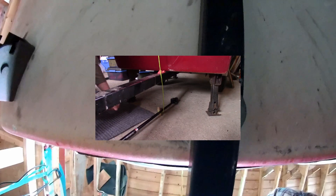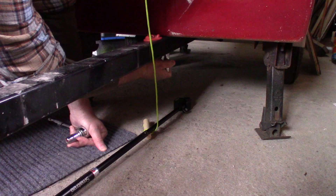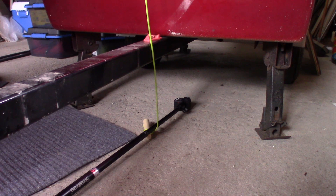I had thought this was going to be a lot more complicated than it is, but the tongue is just one 5-foot piece of 11-gauge square 2-by-2 inch tubing — 9/16ths. I would have thought it was something bigger. So there's only two bolts holding it on. The inside bolt is a 45-degree angle cut in the metal, so the bolt only goes through the top part of the tubing. It's roughly easy to get off — not too bad at all.